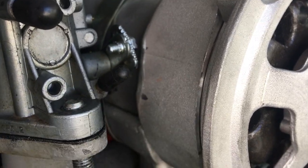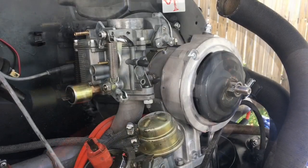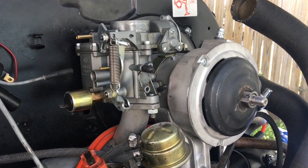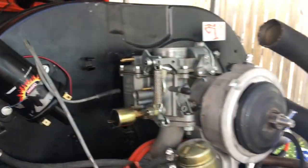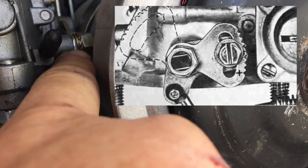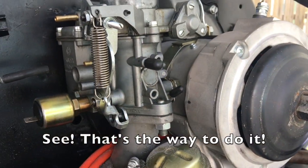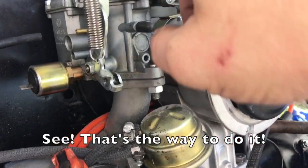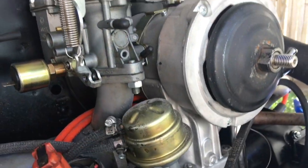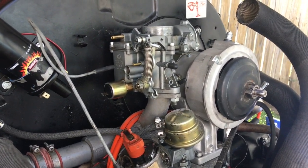This is why Volkswagen guys have 50 cars in their yard. I found another carburetor that had the correct setup for an alternator — the accelerator pump was already configured for it. I took that off and put it on my rebuilt original Solex, and now we get full travel. So we will be putting the engine back in the Beetle and driving to lunch.